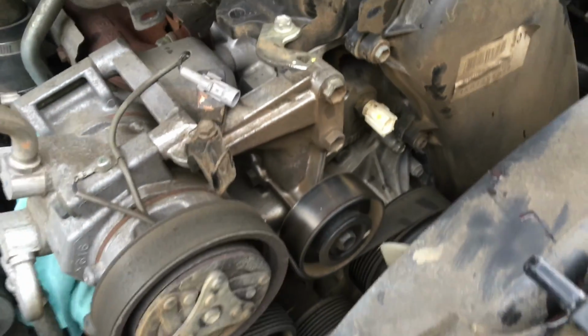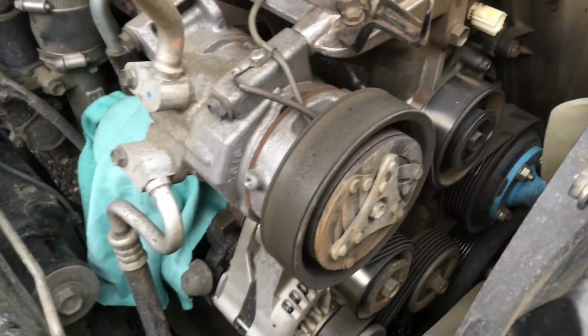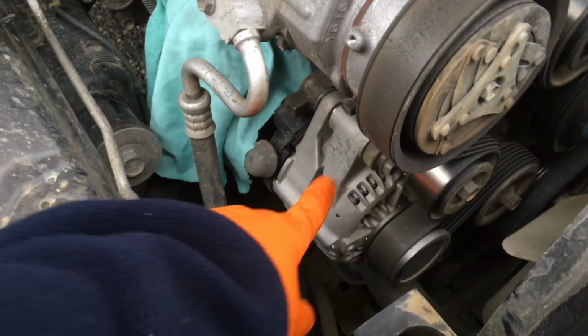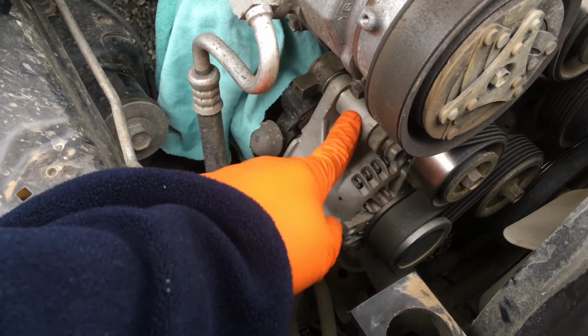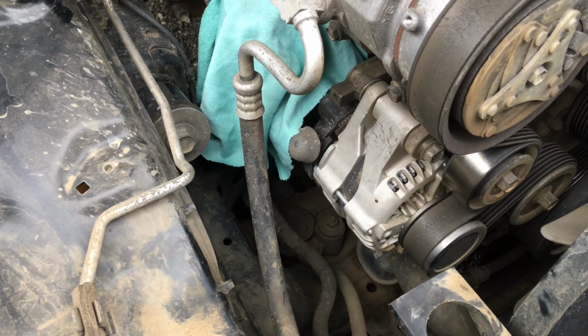We've got the video on this with an engine out to show you in a lot more detail in the VIP group. This one, the whole compressor has to come back, the alternator has to come back. Looks like someone's given that a good tap. That's been replaced at some time and it's had a good tap to get in there. So battery disconnected, as you can see over there, because the wires have to come off the alternator, the plug, the alternator out, the compressor off.